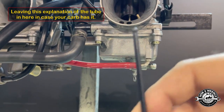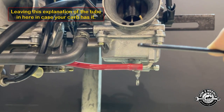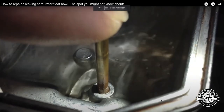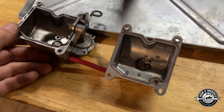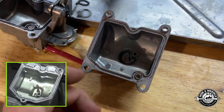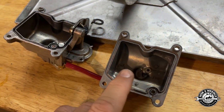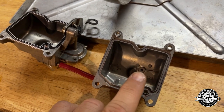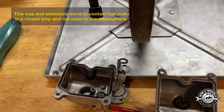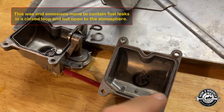There should be a standoff tube in there attached to the same hole so that if the carburetor overfills it'll run out down that tube. I have a video on how to fix those. The first thing we're going to notice inside these bowls is they don't have that brass standoff tube. So think about what would happen if this doesn't have an overflow — if the float sticks or fuel doesn't shut off, for a newer vehicle more concerned about emissions and external fire hazards, the fuel has nowhere to go.